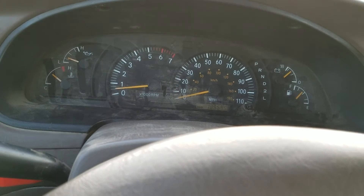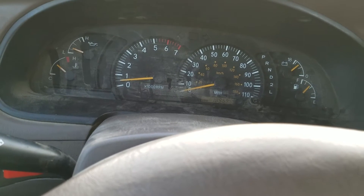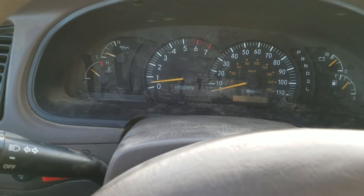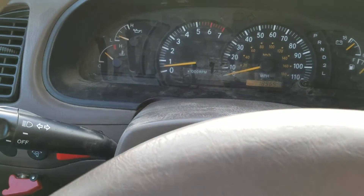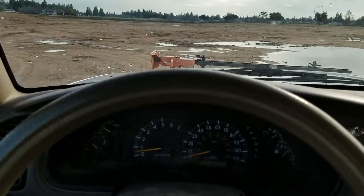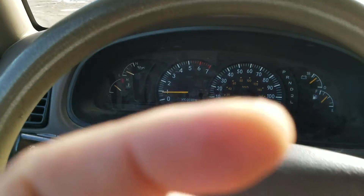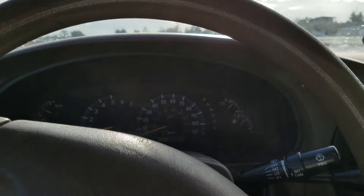Remember what I said when I turned on three-wheel drive yesterday? Basically, there's possibly going to be some torque steer because of the driver's side wheel — the power goes only to the driver's side wheel. So here we go. Let's see if there's any torque. My hands are off the steering wheel — my other hand is holding the camera. And yep, there's some torque there. We know that there is torque there.